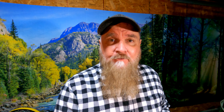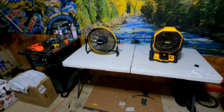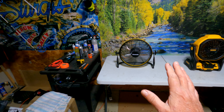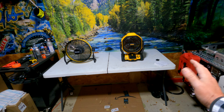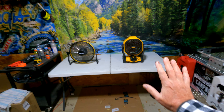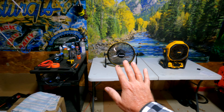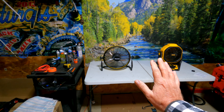Okay, after testing it out for a while: on low, it ran for 38 hours and 38 minutes. On the setting that looks like high on the dial, it ran for 5 hours and 42 minutes. So basically, if you wanted to save battery but still get airflow, just turn it down to medium and you get 5 hours and 42 minutes of battery power.